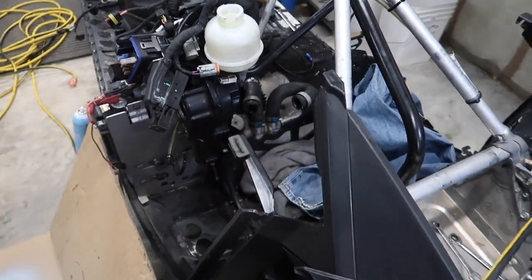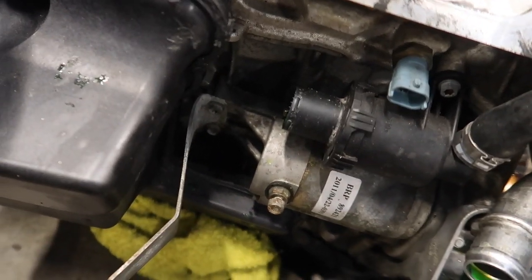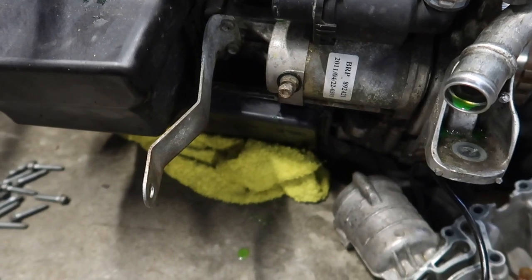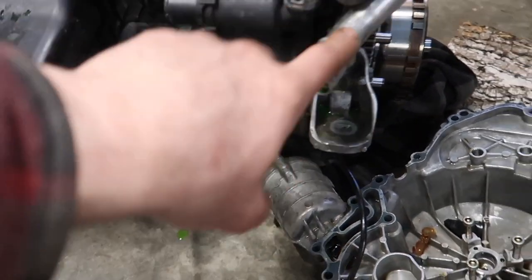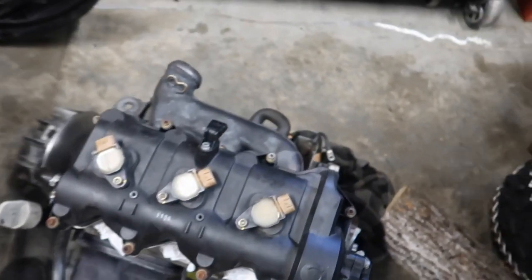That hose up to there probably won't be that common for most sleds, but my sled had already been taken apart by the Ski-Doo dealer. They said they fixed the oil tank but it was still leaking. The motor had to come out, and I assume that clamp didn't get tightened. That clamp attaches right to your thermostat housing — it was leaking down across my starter. There's another clamp here too.